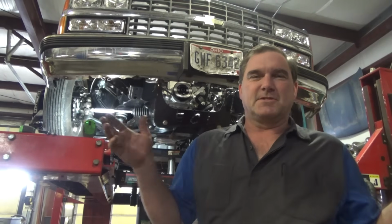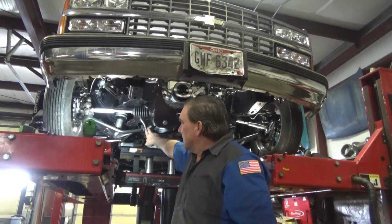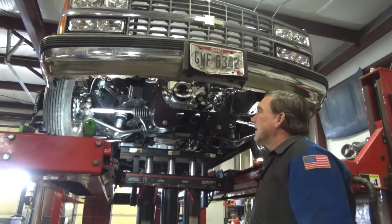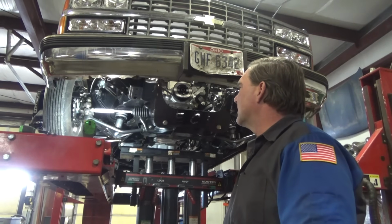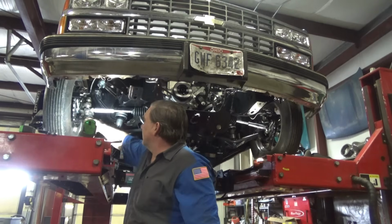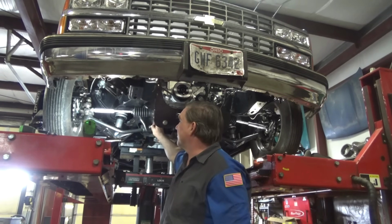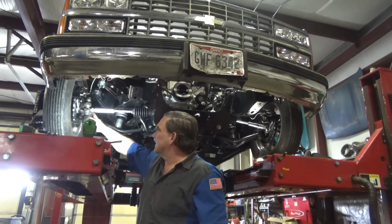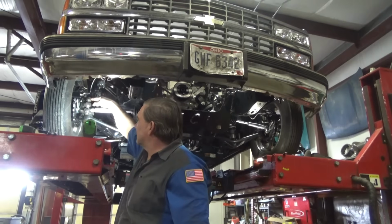Although that probably gives you a really good idea of what I'm trying to adjust in the bump steer, because you can see how the tires sweep depending on where the tie rod end is in relationship to the parallel line between the inner joint and the ball joint. Getting those correct is what creates all the benefit of the bump steer kit. You can see right now, instead of having 2 parallel lines, we actually have a crisscross. This line from here to here, and this line from here to here. You've got a relationship of probably 3 inches vertically from there to there. The problem is we're on the ball joint line here. And where we really ideally want it is closer down.